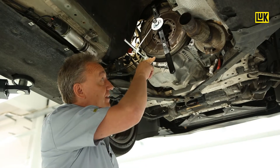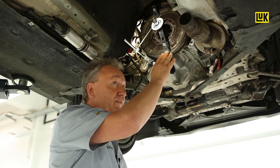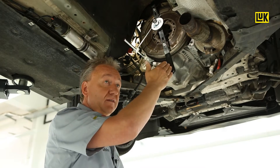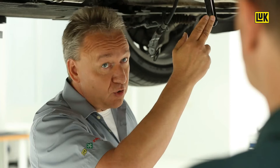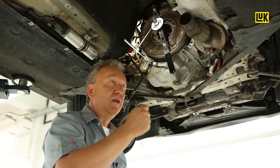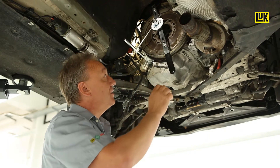There are two further differences. If there is an even number of clutch plate mounting bolts, I can centralize the slotted arm. If there is an odd number of mounting bolts, it cannot be fixed centrally — as a result, we can't check the degree gauge, so the next test method would be counting the teeth on the starter ring gear. As you can see here, we have an even number of mounting screws, so it is placed in the center.